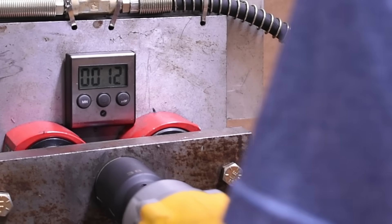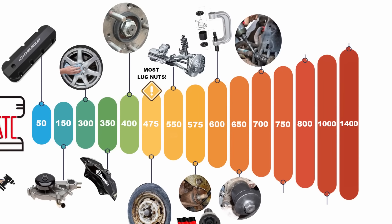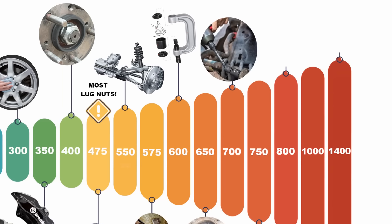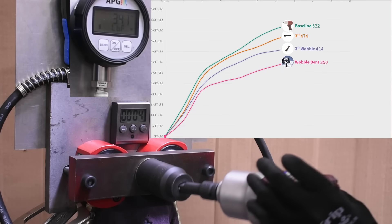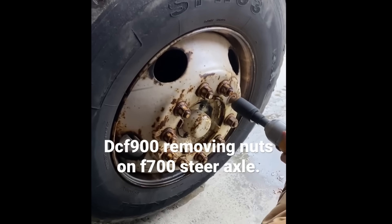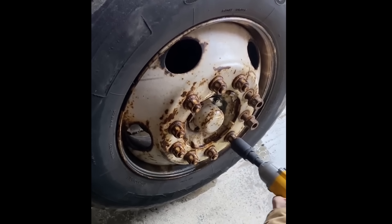Looking at our application scale, few things put up a fight against this tool. Wheel bearing presses take about 5 seconds of impacting. We're much more able to tackle rusted chassis and suspension bolts using extensions and swivels, which can lose 40 to 60 percent of your torque. That's why we need torque monsters like this — try removing a 220 foot-pound spec upper control arm bolt off a rusted car with an extension and a swivel. Crank bolts are no problem even without a weighted socket, and it can handle big rig lug nuts such as 33mm hex — a surprising amount of them.